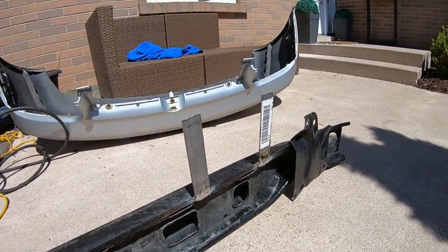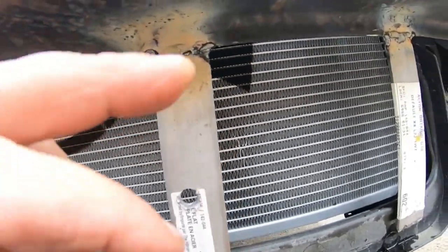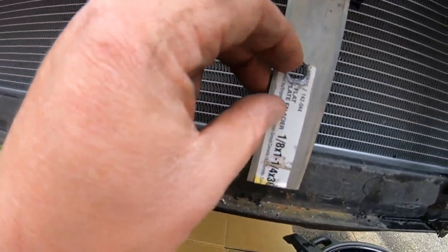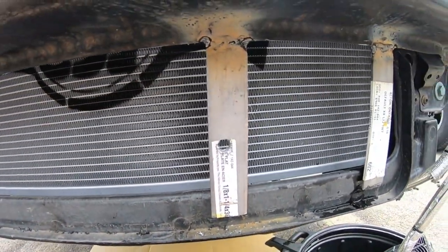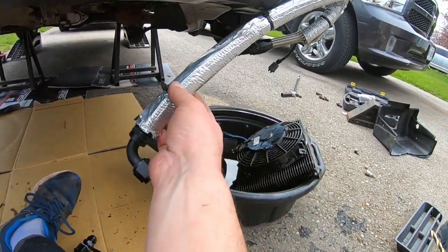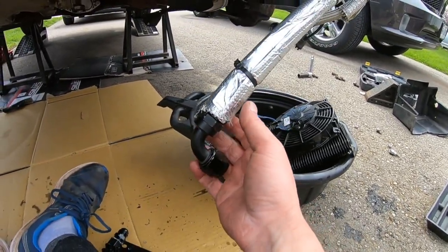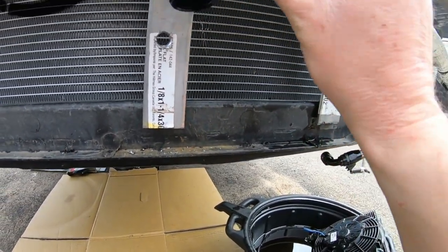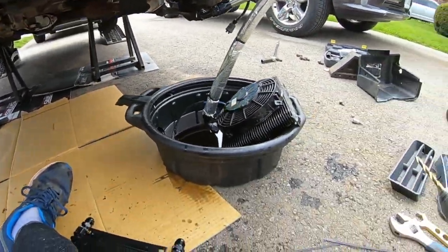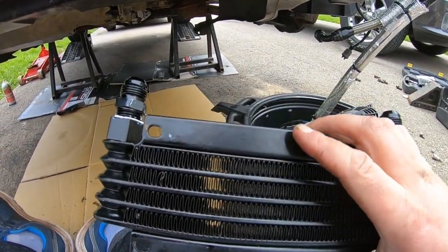There are our two little mounts for the oil cooler - I'll clean them up, give them a scrub, and cut them down a bit so they're not all the way to the bottom of the lip. The bumper is upside down right now. The reinforcement bar is back on. I also added the secondary dash-10 AN inline extension. I just need to bore out a hole slightly and find a nut and bolt that fits since the others don't.